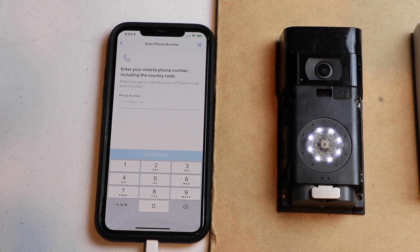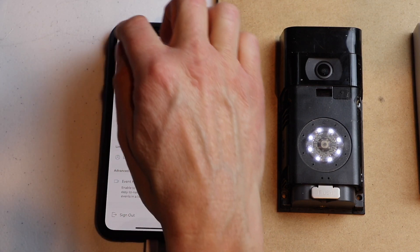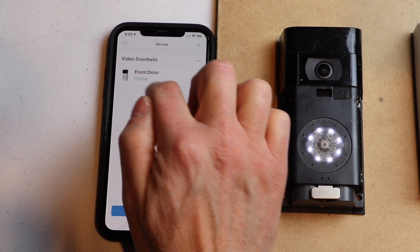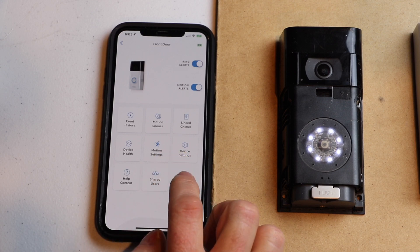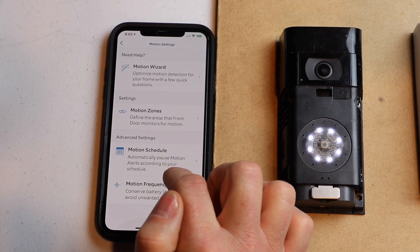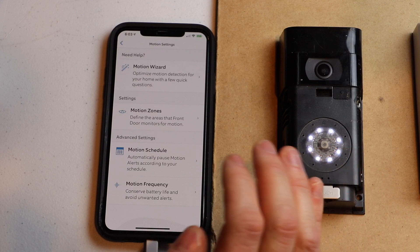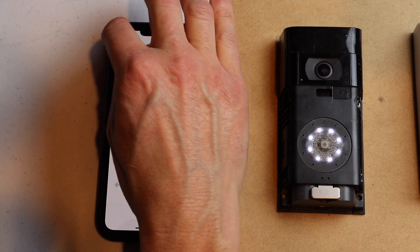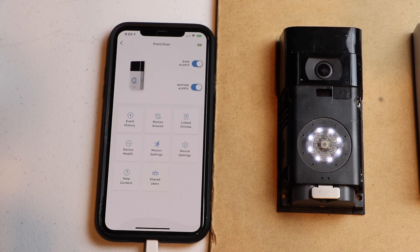Two-factor authentication makes your account more secure. If someone tries to log in, it'll notify you and you can give permission by putting in the six-digit code. The last thing I wanted to look at: click on the menu, go to devices, click on the doorbell. This brings you to your settings page where you can customize things — you can go into motion settings and customize the zones. I think you should wait and see how it acts first. If it sends too many or too few notifications, then adjust. Start with standard, then adjust from there. We're pretty much finished — please subscribe.